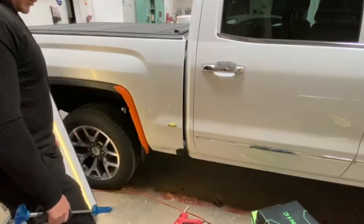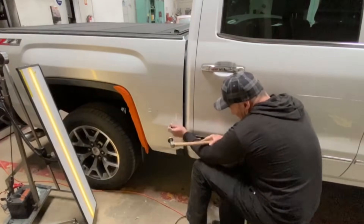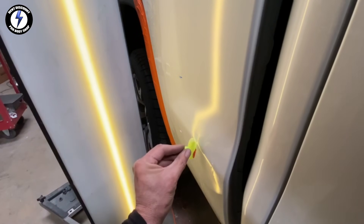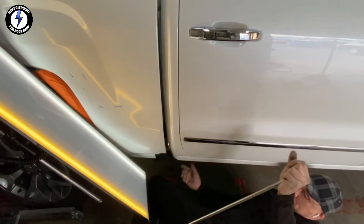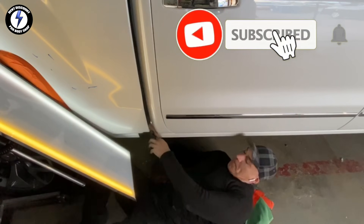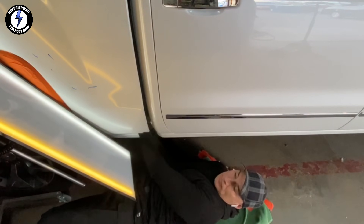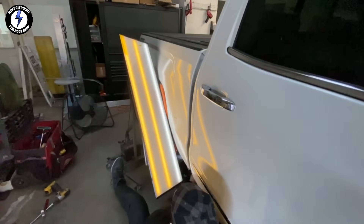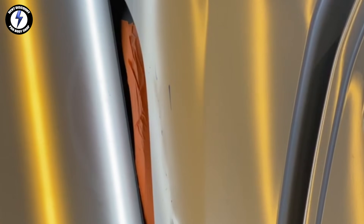Notice I just pulled the majority of this dent using these plastic tabs — bedside pulling, making it look easy. Some of these body shops around the world may need some collision glue training to reduce their Bondo filler use. We know how to put it back together with glue and save you some time. Proceeding to the back side of the truck bed — I found a nice leverage point underneath. I'm really not pushing; I'm doing more twisting of the tool, flexing with my forearms and using less shoulder.